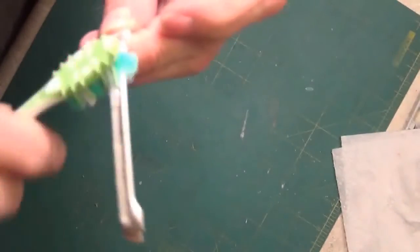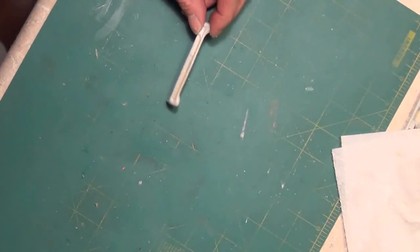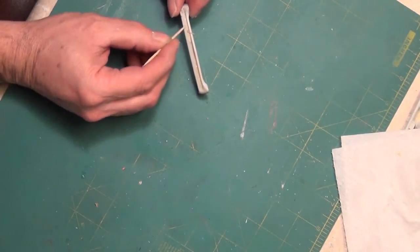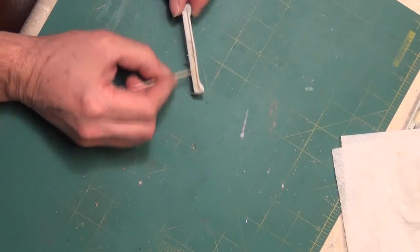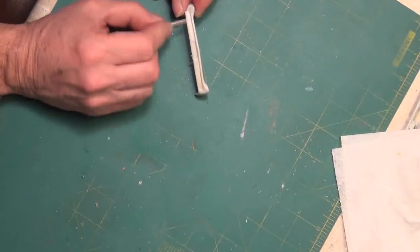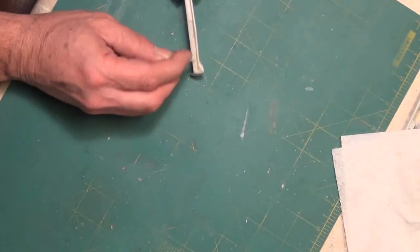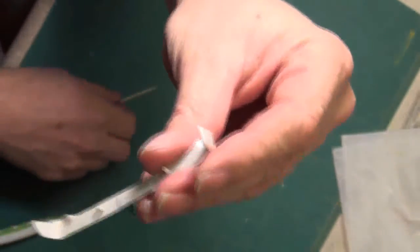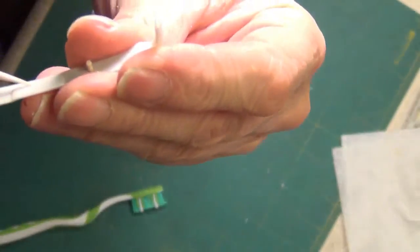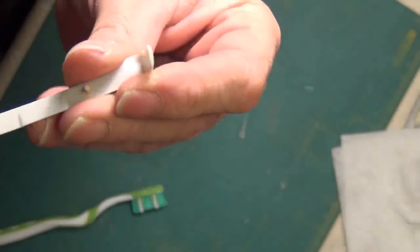And as you can see, the stuff's flaking and peeling and carrying on up in there. You're still going to get some stubborn parts, where you might, let me grab a toothpick, but it's not going to tear up your part or eat into it because you're scraping it with that toothpick. As you can see, the stuff's flaking off. It's going to have little areas where it's sticking a little harder than others. And at the most, you'll have to take a toothpick and just scrape it out a little here and there. When you looked earlier and you saw all that chrome stuff in there, you'll find little spots here and there, like right there. Boom. And just knock that out. It just comes right out. So it does stick a little still, but between a toothbrush and toothpick, it just comes right off.